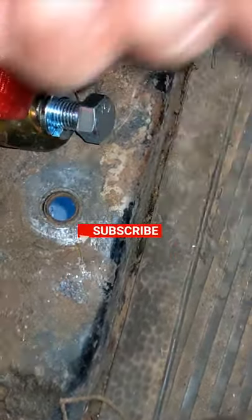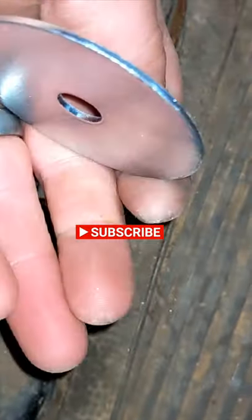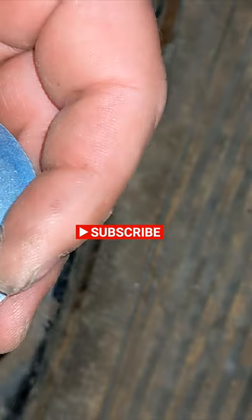Using the provided hardware — it might be a little tough to get to, so tilt your seat. Here we already have a captive nut welded in, but if you didn't, you would just drill through and use something like a very large fender washer with a nut on the back side.